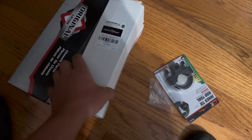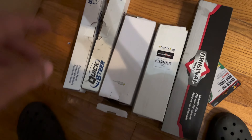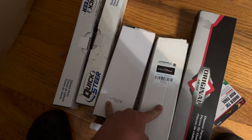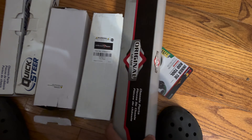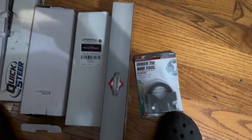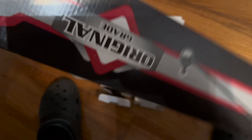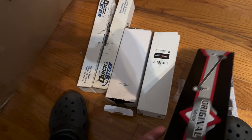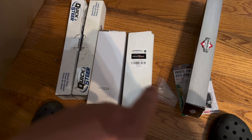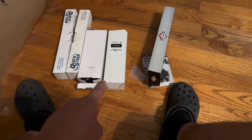So if you guys watch my shorts, you saw that I have like some crazy wheel situation. We have the parts here to fix that. These are tie rod ends - these are outers. This is a new sway bar end link, and this is the tool you need to get the inner tie rod out. I got this because I have a new one on the other side, so might as well go new all the way around. Unfortunately they're not go-fast parts, but it is a necessity.